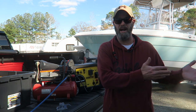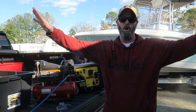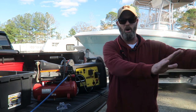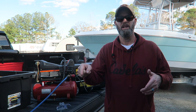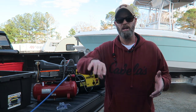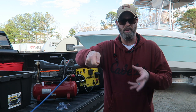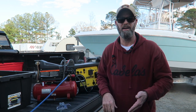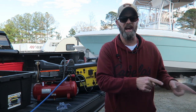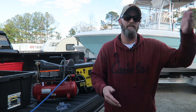Okay, so essentially what you're doing is you're pressurizing your lines with air and forcing the water to all the faucets. Any place that water comes out, you're pushing it all with air. And then you're releasing the water from each valve inside the trailer. Cold until you reach nothing but air. Turn it off. Turn on the hot until you reach nothing but air. Turn it off and move to the next water source, which would be the bathroom in my case.